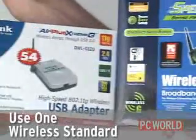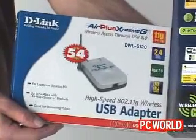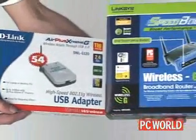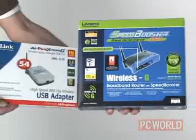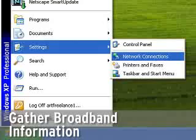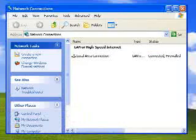While some standards such as 802.11b and 802.11g are compatible, using them at the same time can reduce your network speed. Gather the information your ISP gave you about your broadband connection, a login ID and password for example. If you happen to have a fixed IP address, you'll need to know it as well as the gateway and domain name server addresses.